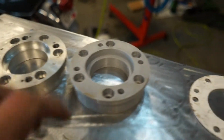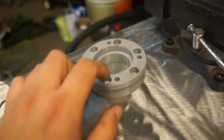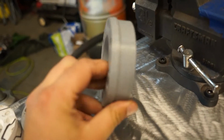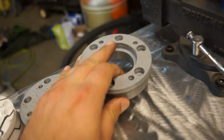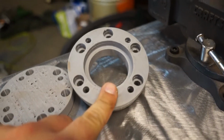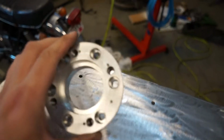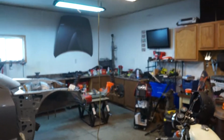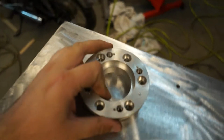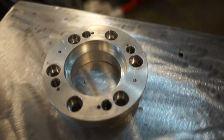part as this. And once I had this design kind of figured out that fit in the car, I was able to actually use finite element analysis in SolidWorks to prove out that this would take the torque needed and that it's not going to just completely explode while driving. So looks like we're good to go here, and I'm really excited that it turned out so well. Everything fits great, and we have our drive shaft, which is super exciting, and I was really nervous about doing it for some reason, but we got it done, and that is going to be the heart and soul of this build, I think.